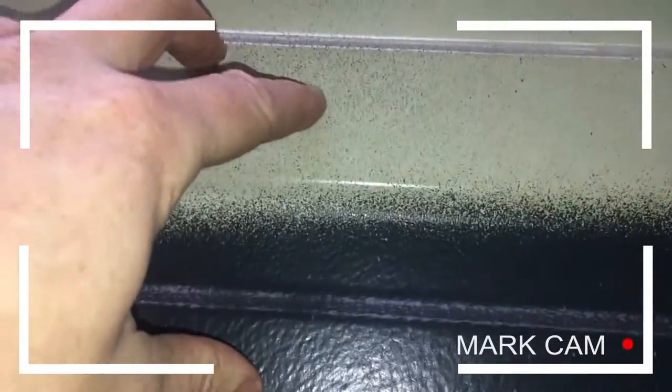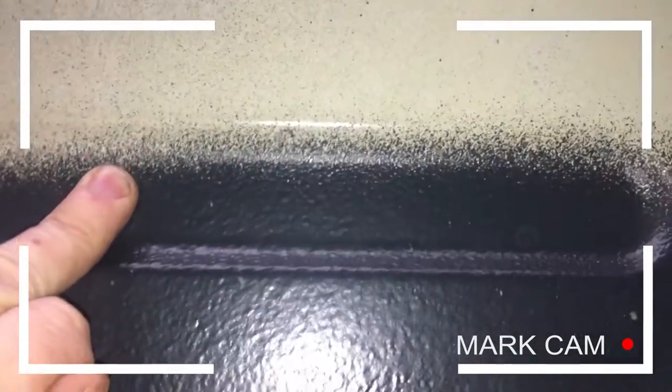Looking underneath from where the second one's going to go — we have a beam here, the main chassis rail running up to the spring, a beam underneath there, and the floor ribs here. Ideally I want to be between these two ribs, somewhere around here, making sure it's 45 millimetres. It's going to take a lot of measuring and jumping in and out of the van, but once we've got that pilot hole in and we know it's in the right place, we can get cutting. Don't worry too much if you have to drill another pilot hole within a small distance because you're going to be cutting it out anyway — as long as you know which centre hole you're working to.